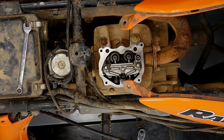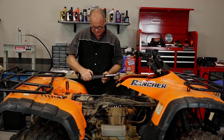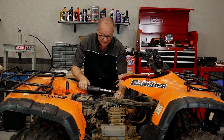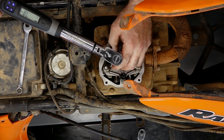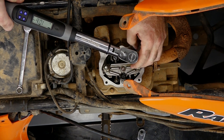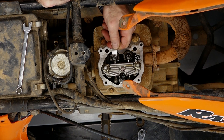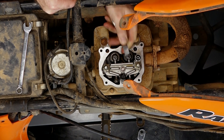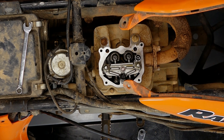Now here's when you need to get a torque wrench. We want to set that to 12 foot-pounds. Now there's a chance when I torque this down it may in fact move the adjuster, but we're going to make sure that didn't happen. We were pretty close to the 12 foot-pounds so I didn't have to move it far — pretty close on that one as well. But I still want to go back and verify that it didn't move any. I can let go of it and it'll hold it there, but I can pull it out — that's what you're looking for.